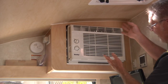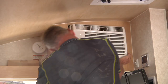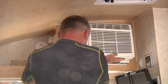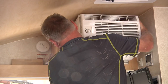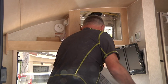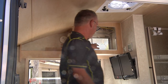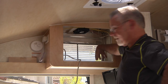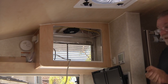With the air conditioning unit, this is going to lift up and slide out. It's a little heavy for some people, so if you need help you could have a second person to help shift the weight. These two feet here actually come above the tray and we'll slide the unit out. Pick it up, angle it out just a little bit, and it sets down very simply and easily. Now you've got complete access to your air conditioning compartment. The factory has left a lot of debris in here — I suggest you get a shop vac and vacuum it out because the drain will clog; people have complained about that in the past.